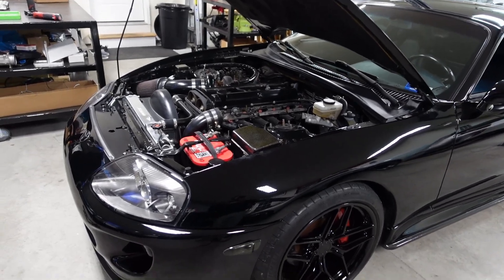I'm going to try and detail as much as we can within reason. I hope this video was helpful. To reiterate: if you're having a problem with your AC, check all those things — go through all the wiring — but make sure you have pressure in the system. The reason I didn't do it was because I wanted to make sure everything else worked ahead of time, but apparently it needs to be pressurized first. Kind of a pain, but good to know, and I'll have this video to reference for myself too. If there's anything you guys need help with, any questions or concerns, let me know down in the comments below. Peace, guys.